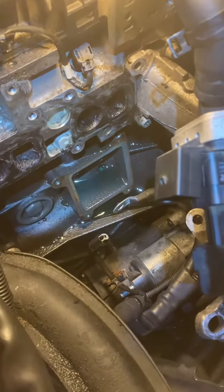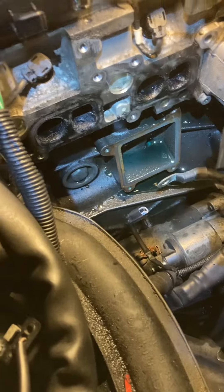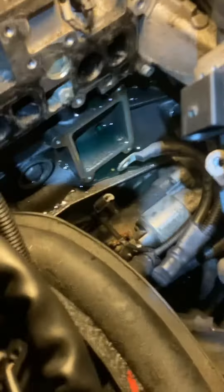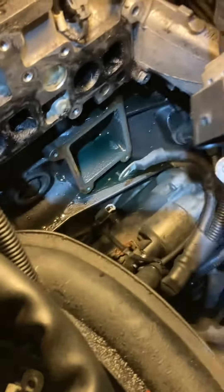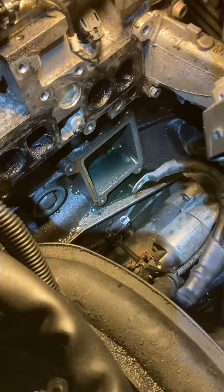There's the heater blower — it's located right under the inlet, which is a real pain to access. That's it coming out of there. I'm pretty sure that's the problem: you can just see the wire coming from the starter motor. I'm pretty sure it was shorting out into these heating elements.